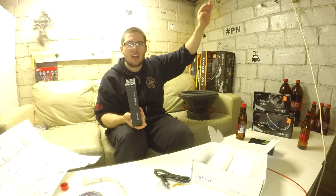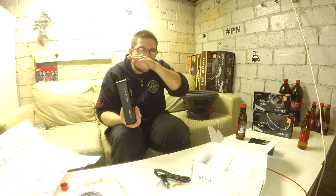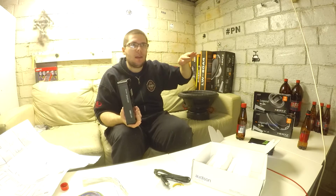Some high-end OEM head units, like in the Porsche Cayman, have a roughly flat line. Now in, let's say, the Mercedes-Benz ML series, which has a nice sound quality package, the equalization is just so awful. Maybe it is because some of the head units actually equalize and have some measurements taken, some time alignments on the head unit itself, and when you take the signal and amplify it yourself, you need to equalize